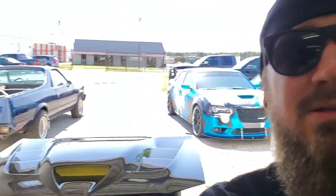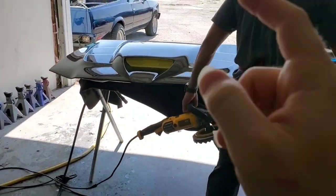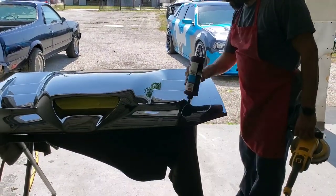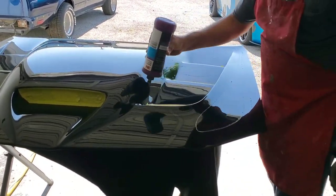That's pretty impressive - Chendo is a bad dude. As many times as we sanded this hood, which has been a lot - it was blocked two or three times before primer, then got primer, then blocked two more times, then painted with clear coat. A lot of sanding at 2000 and 3000. The 3000 finish alone was pretty impressive, and now we're hitting it with the polish and it's ready to go on the car.